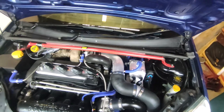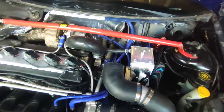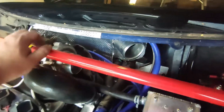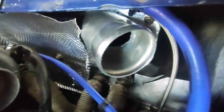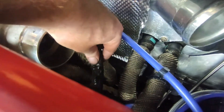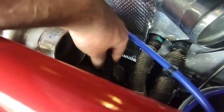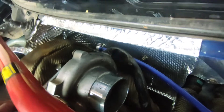I'm going to rip this off now and see if I can see anything. It's actually easier to just take it all off in one go rather than pissing around for the time it takes. So this is off and I don't know if you can see we've got some vacuum pipes here. This is the pipe, obviously all heat shielded. It goes to the wastegate. Unfortunately, in one way, it is completely intact and connected — connected down to the port down in there. It's on the boost pipe, onto the nipple there. So it looks like we might have a wastegate issue, which is unfortunate.